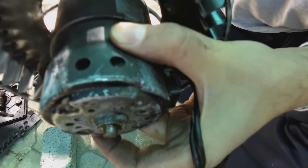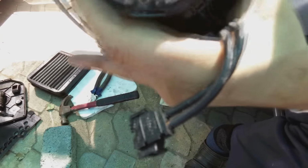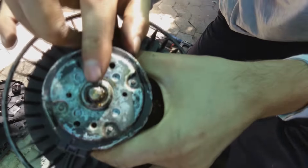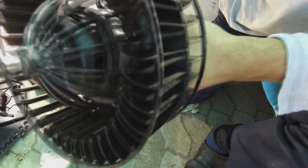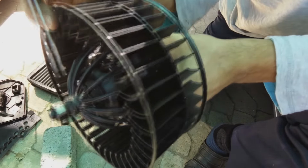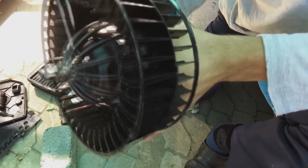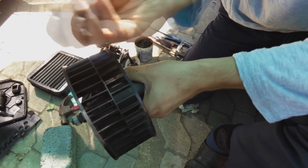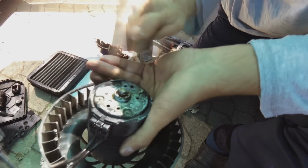Okay, the brushes are now quite tightly on that commutator. Then I also just added some grease there. It's quite hard, but you can add some grease there. You just put it on a screwdriver, you lift this thing up, it moves, and you put the grease on the edge of the screwdriver, you turn it, and the beauty about grease is when you turn it, it actually sucks the grease in, as what's happening there.